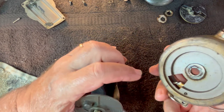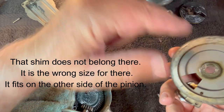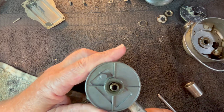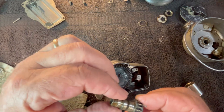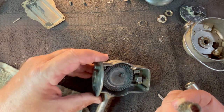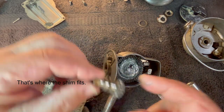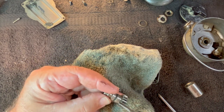There comes the rotor off and this rotor looks like it's got one shim in it. The pinion dropped out from the back — no shims on the pinion, none here either. That takes the pinion off — it's pretty nasty looking too, let's wipe it out a little bit. I'm going to have to do a little scrubbing — this thing's got some beefy gears in it. Look at the size of these things — big teeth. That grease doesn't want to just slide off, so let's try my wire brush on it. It looks like it's coming off okay.